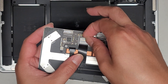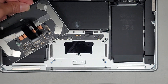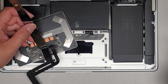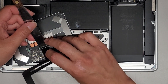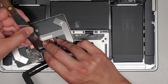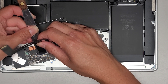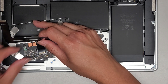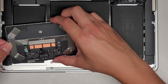We're going to flip this latch here. Now that that's up, we should be able to pull this cable out. There's more adhesive obviously, so let's go ahead and get some more isopropyl alcohol under there. I just use this little thin tool here, get a drop on there, and that should be enough to slowly work our way under. You don't want to rush it, just slowly go — and it's coming out. There we go. We can pull this cable out. We got the cable out and here's the old one.